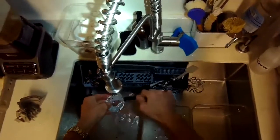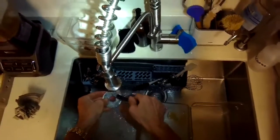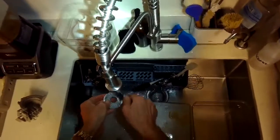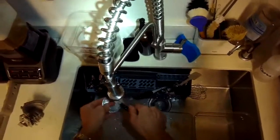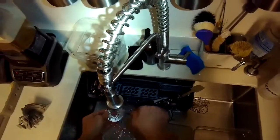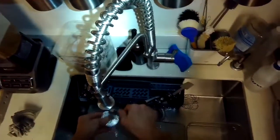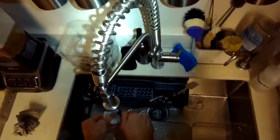We're using this brush to clean off all that stuff — it's really baked on there. Now it's starting to look nice and silvery and clear, which is what we want, meaning all the holes are open and the water can just shoot right through. I warn these customers not to use the dishwasher to steam off labels because this is a classic problem that clogs up the circulation and then the dishwasher really just doesn't work.